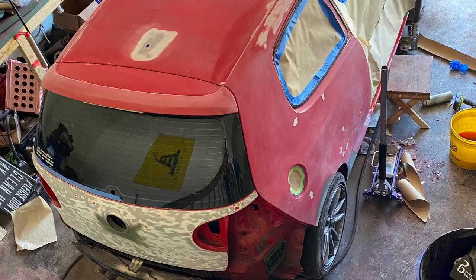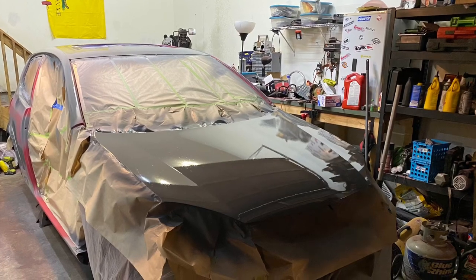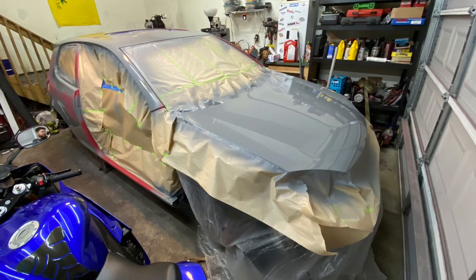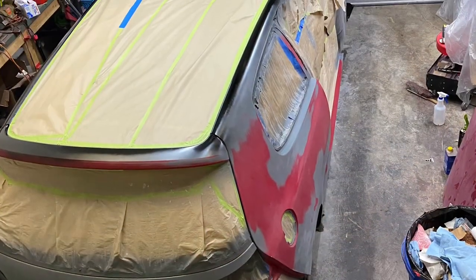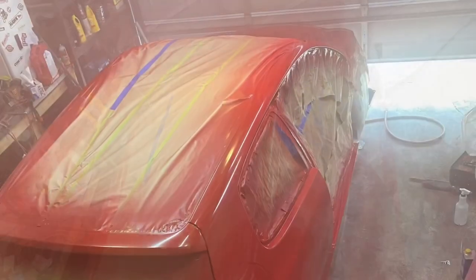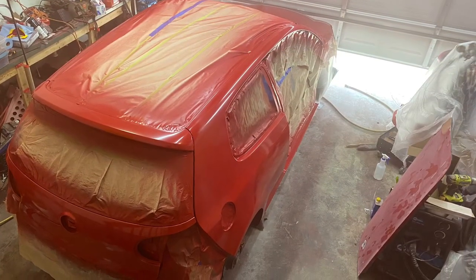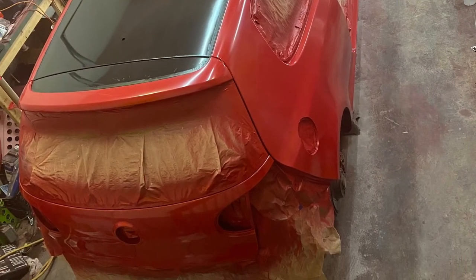I got the clear coat blown off, sanded down, and all that stuff — so this is kind of a slideshow of the progression of primer and paint. You can see here I touched in the primer basically anywhere it was needed. It ended up being a little bumpy but got that sanded down after it cured. Sprayed the black on the roof, masked off what I wanted to stay black, then proceeded to start spraying the red. You can spray the parts that had primer on it first to get some more coverage there, then eventually go full saturation on the color.